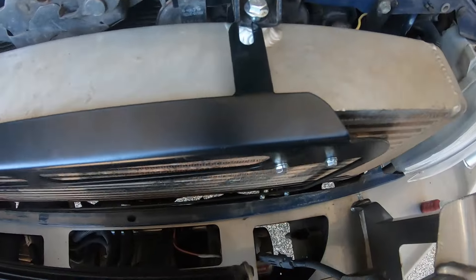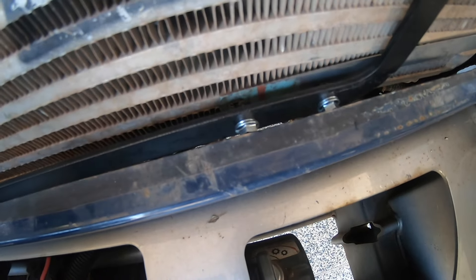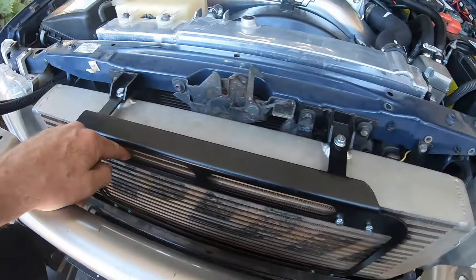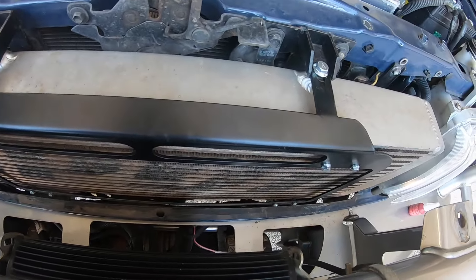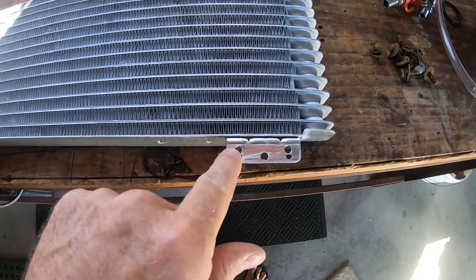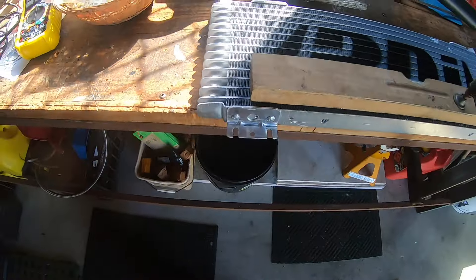For the last few mods I've done on this it seems to have worked. I've only got one of these brackets on the bottom. What I've done is stuck in a little steel ruler between the rivnuts and the front mount intercooler just to give a gap — I don't want the rivnuts rubbing up against it. That's in nice and tight now, and I've made sure I can fit my ruler between the back of the rivnut and the front of the front mount intercooler across all eight rivnuts. Now I'm going to modify the bottom bracket of the cooler as well. I've already modified these bottom brackets by trimming them up and redrilling the holes. What I'm going to do now is cut the aluminium out from that hole at the top of the screen all the way down to the end — so there's a slot. That's better now, you can see the slots. I'll go over them with a file and get rid of the rough edges.